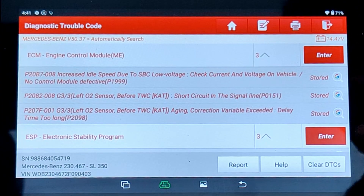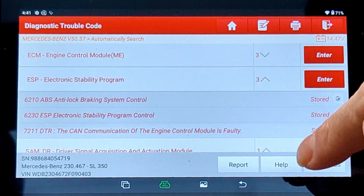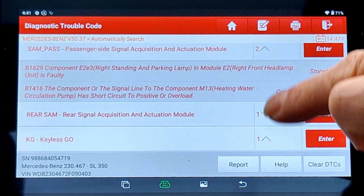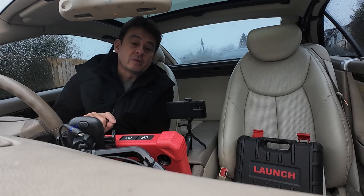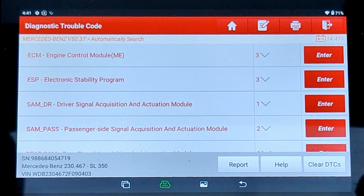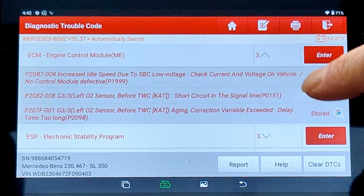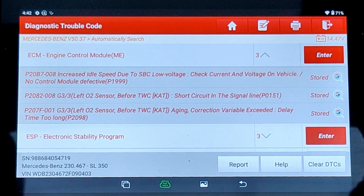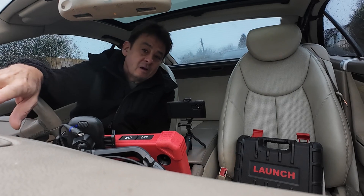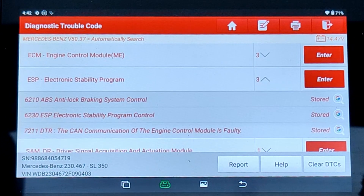They're all the ones I've got issues with. Don't get too alarmed - they always look worse than they are. If I go and click on the little down arrows there, it kind of summarizes it a bit more. Without the description of the fault showing on the screen, these are the main engine control units, the ECUs that we have faults with. Looking at the top - engine control module, I've got three faults. If I press the down arrow it will tell you: increased idle speed due to SBC low voltage. I've said this many times - when you get low voltages on a car it can give a whole myriad of faults. I have had a low voltage because it's winter and I'm not using the car quite as much. Next one - ESP, electronic stability program.